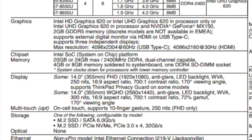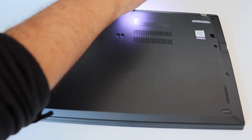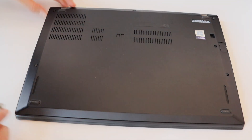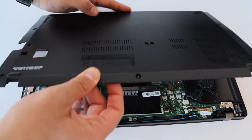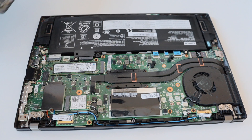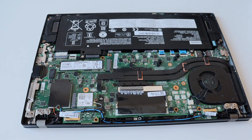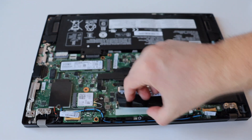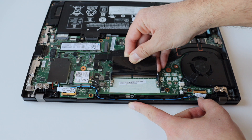This laptop is from 2018, so it's a little bit old by today's standards. It works with DDR4 RAM at 2400 MHz. To access the system board and add more RAM, I need to remove the back cover on the base of the laptop. I'm using a screwdriver and a plastic card to carefully remove the cover from the main chassis. Let's have a quick look at the motherboard — it's a green printed circuit board with white silk screen. The SODIMM slot for RAM is located next to the CPU, so I'm carefully plugging in a compatible DDR4 RAM stick.